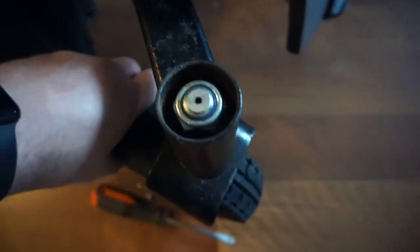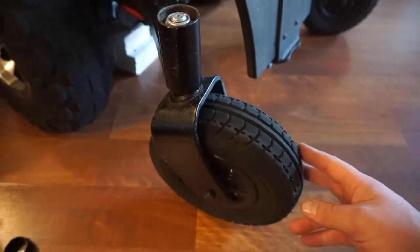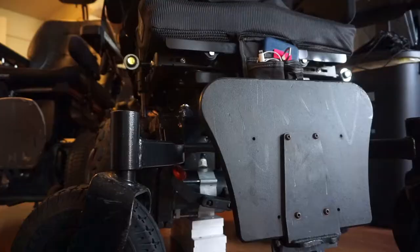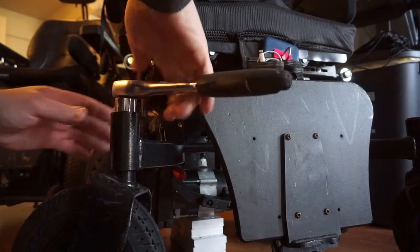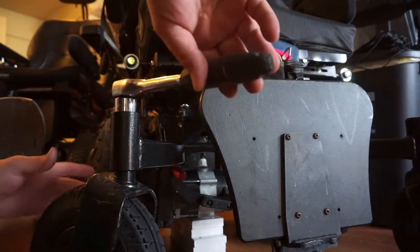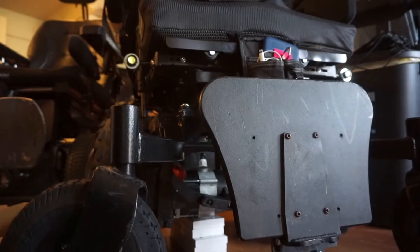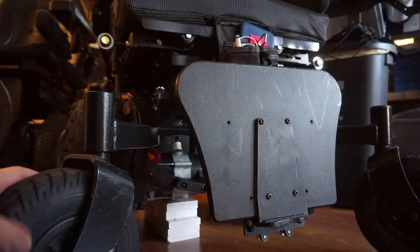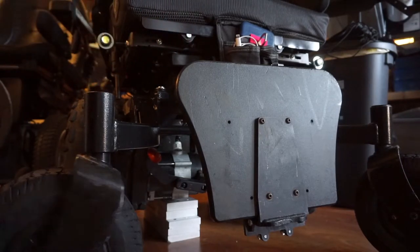Sorry, neighbors. Giant nut — you just have to tighten it down a little bit so this thing is not as loose. There isn't a specific torque spec for these. The way they measure it is when you give the wheel a fling, it should turn about three quarters of the way after a medium fling. As you can see, it's doing way more than that. Let's get this one adjusted first. These are large — that's a 15/16ths socket and a half inch drive ratchet. This is not going to take very much turning at all. So basically just hold the wheel and give it a little tweak. I just tightened it too much — that little tiny bit I turned it was way too much. That's how fine of an adjustment this is.